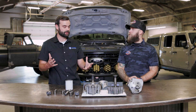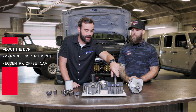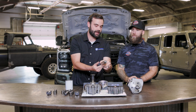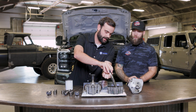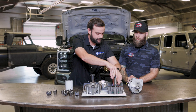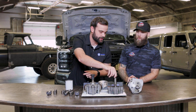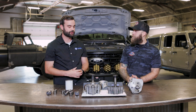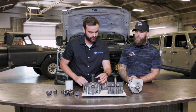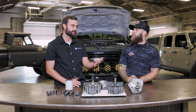At 350, that's why it actually has 25% more displacement than what you find from a stock CP4. The secret — the bottom end design that makes it better than the CP4 — is that it has a patented eccentric offset cam and it's actually pressure lubricated with fuel through the cam. That bushing rides on that cam, and as that offset cam goes around and around, two plungers or pistons inside the pump create your high pressure fuel. So it's more of a piston style rather than a cam-and-roller style. That bushing spreads the load within the pump — you don't have rollers that are going to cause friction, you don't have a bucket that can turn sideways, you don't have a roller that can seize. It's a much more robust design.